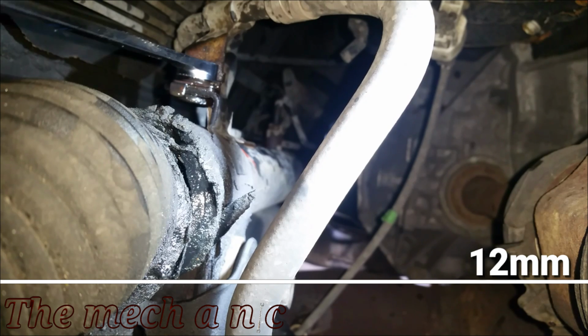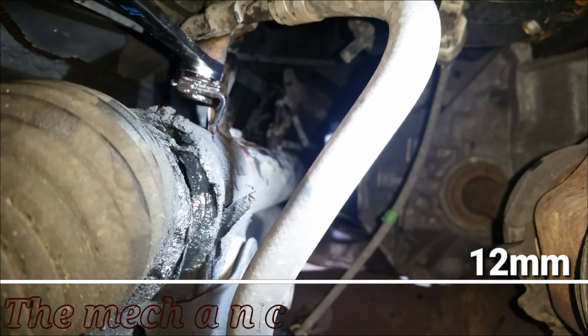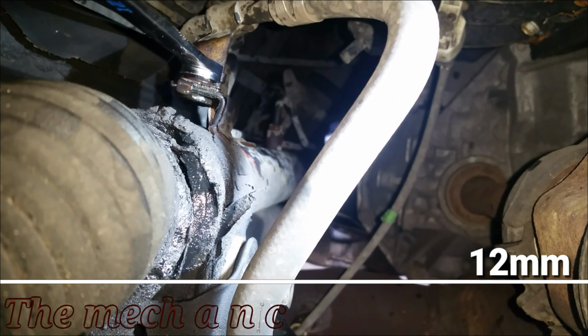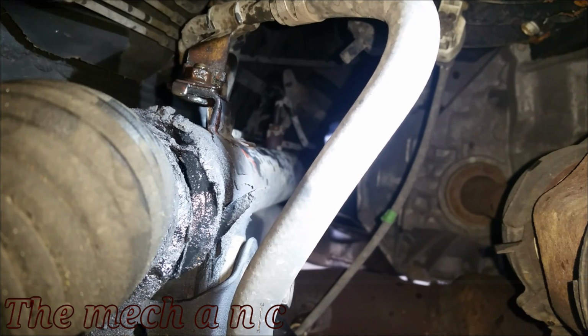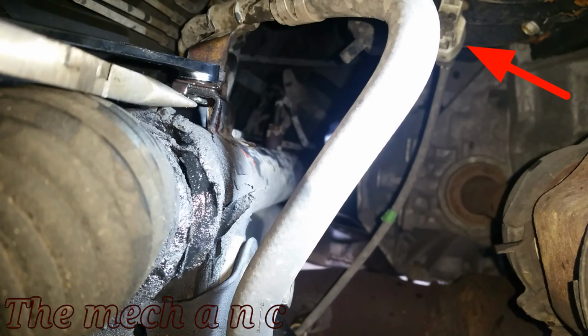In this frame you could see the oxygen sensor harness is sitting off to the right side, and I didn't disconnect mine or anything, but when I was removing my rack and pinion I did notice that it was in my way quite a bit. So a little helpful tip for you is just go ahead and remove this oxygen sensor right here, right at the harness, or at the connector I should say, and it'll just make things a little bit easier for you.